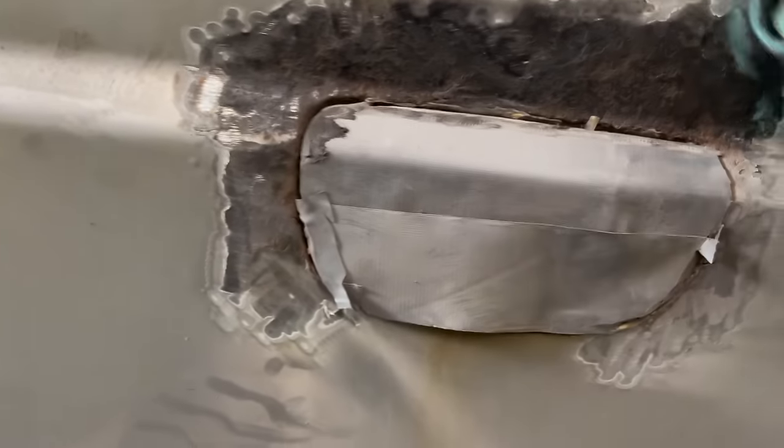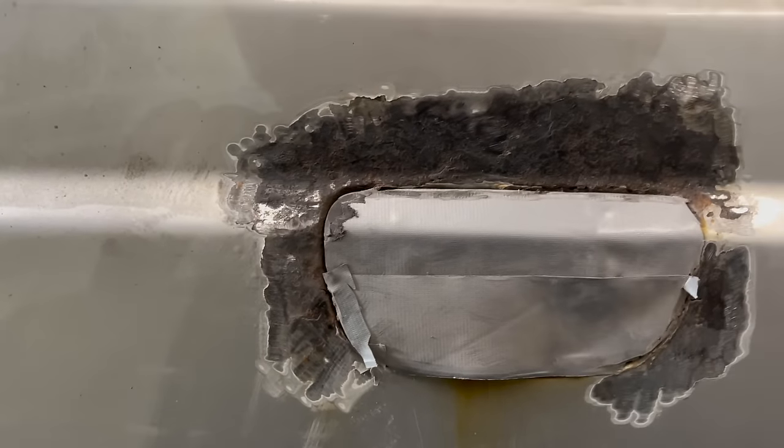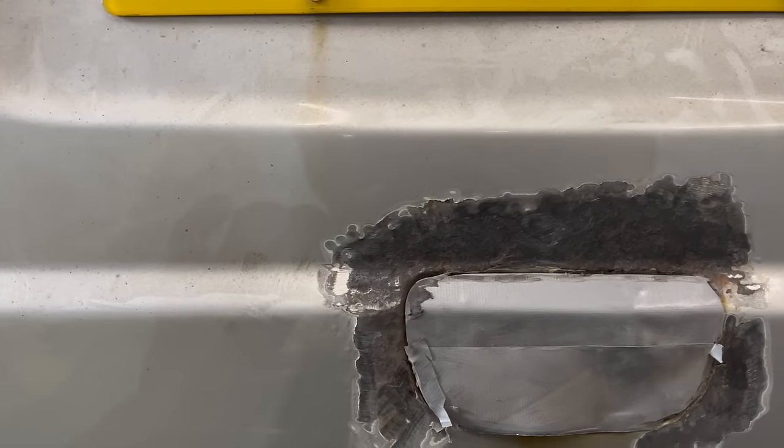I'm just gonna square this up. We'll have a look back when I've squared it up a bit. Now this is just a rough repair, honestly. This is nothing to stand, and my duct tape, I've burnt through it, but I don't really care. I was gonna take the door handle off, but it's got that much timber behind. I'm just gonna scrape around there with a screwdriver, get some masking tape, mask that up a bit better, give this a scuff up, and a thin bit of filler over there, knock that back, and then we might put some rust cure on it just to stop it bubbling back. But when it gets to this stage, and it's got what I call the death, that will just keep coming back through and coming back through.